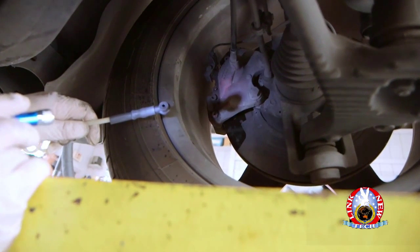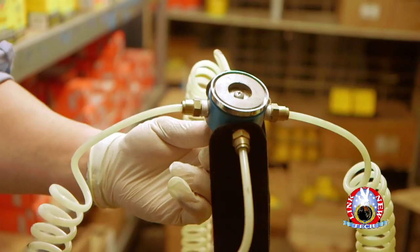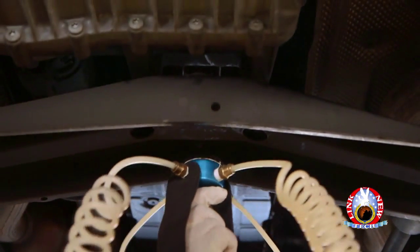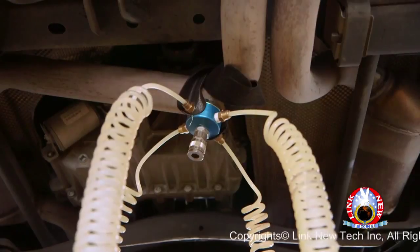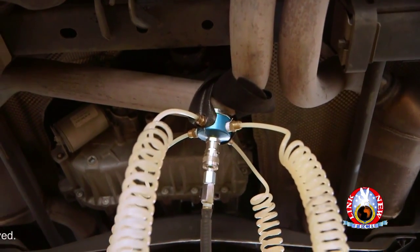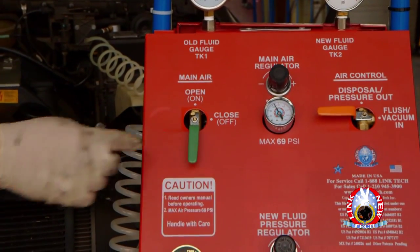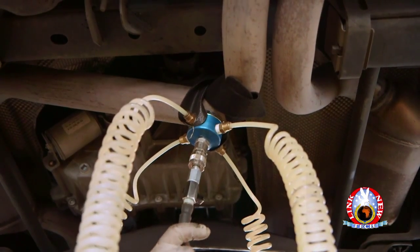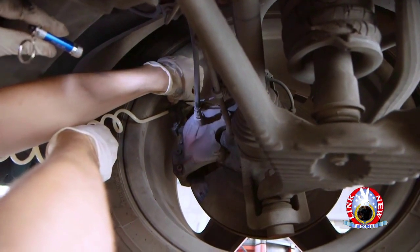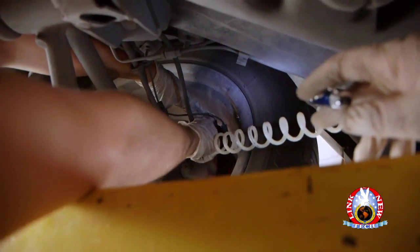Third, you'll need to gain access to the vehicle's underside and the brake calipers at its wheels. Connect the magnetic manifold to an appropriate metal surface in the center of the vehicle using the Velcro belt. Connect the old fluid Tank 1 coil hose to the quick-connect on the magnetic manifold. Turn the green main air valve to the open position and the black valve on the quick-connect coil hose to open. Connect the rubber brake bleeders at the end of each of the four brake bleeder coil hoses to the brake bleeder valve at each of the vehicle's wheels.